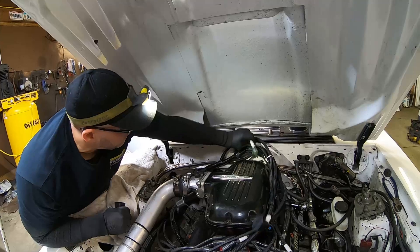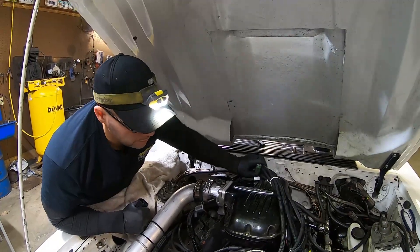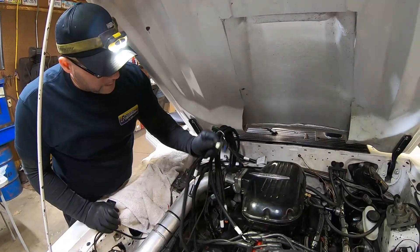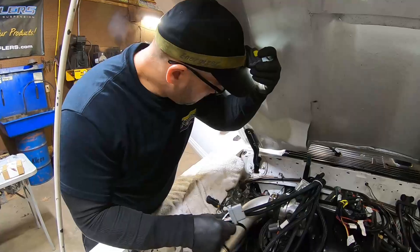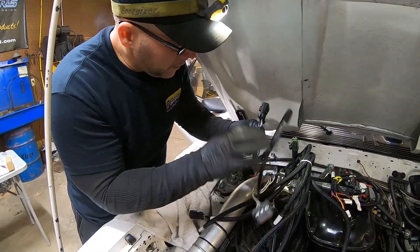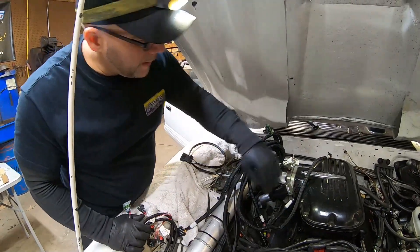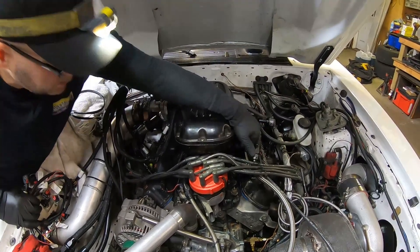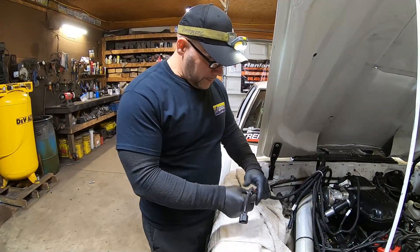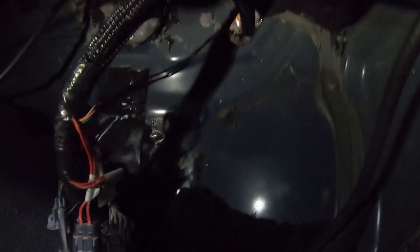There's probably going to be plenty of wire since the injector harness goes right here. One thing I had to be careful of is since I moved the ECU back a little further than normal, are all my harnesses going to reach? Engine coolant temp sensor, oil pressure, IAC — moving right along identifying everything. Here's my TFI harness that was rewired by MF Customs as part of the gen 2 kit. Injector harness checks good. IAC, TPS, intake air temp, wideband O2 adapter — we just got a brand new wideband out of our other kit. No heater box definitely helps — this is more of a street-strip race car.